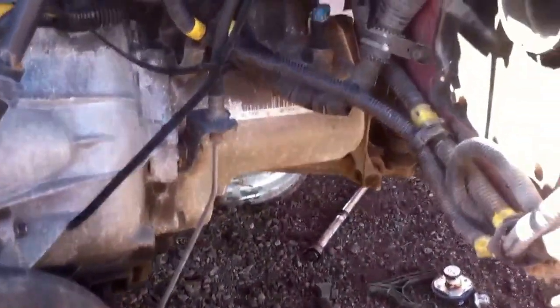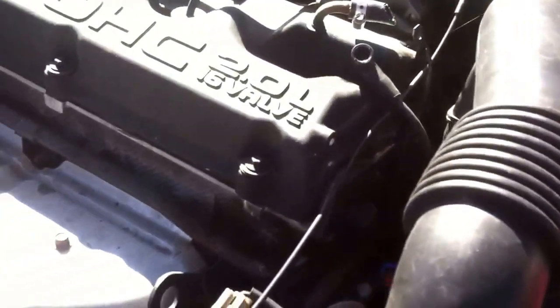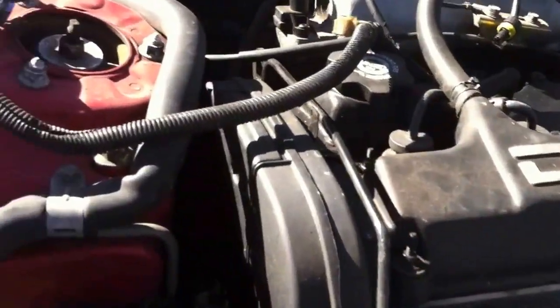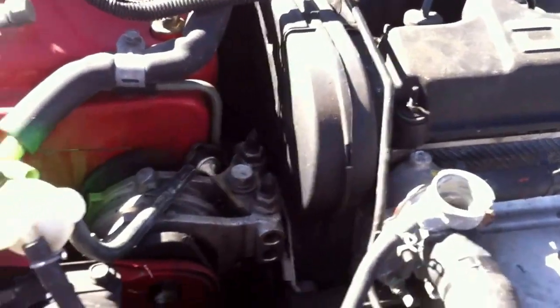Look at the transmission up here along the inside wall. Over top you've got just electronics and wiring. The exhaust is a blast to take off too. And that is how much space you have if you wanted to change the timing belt in the car. You also have to consider that there's a water pump buried down underneath that timing cover as well.